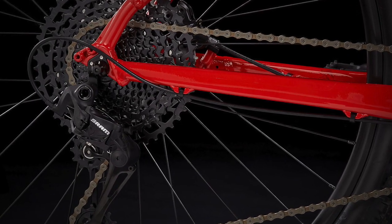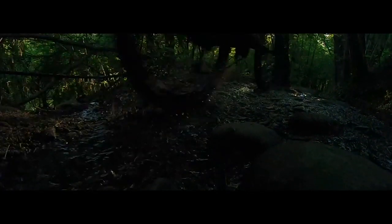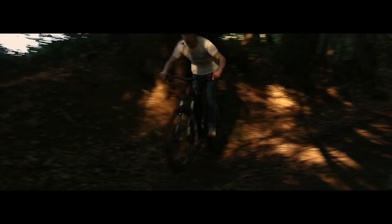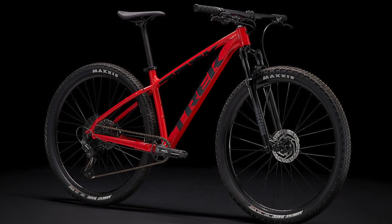At the back, we have the 12-speed Eagle cassette — the 11-50 — meaning the smallest cog is 11 teeth and the largest is 50 teeth. Having a 30-tooth chainring up front and a 50-tooth cog at the back means a huge amount of low gears to play with. That's great for mountain biking in India, where there are no mountain bike parks or lifts — you have to climb using your bike, and you can never have enough low gears. On the flip side, the 30-11 combination doesn't give you enough tall gears, so you won't be able to maintain speeds above around 40 km/h on flat tarmac. But this bike is meant for mountain biking, where more low gears than high gears is always the better option.